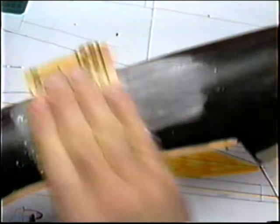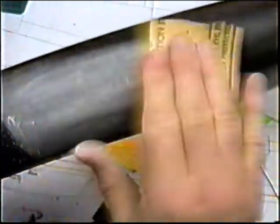See, from seeing how this is sanding out, one thing I can be sure of is I didn't need the second coat of clear. I could have gotten away with one coat of clear, I think. Again, another weight saving, every time you can shave off a coat here or a coat there. So what I'll do is sand this until I see I'm almost going through.